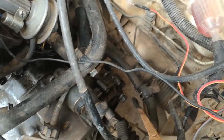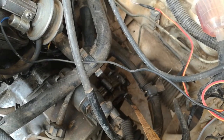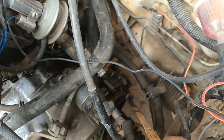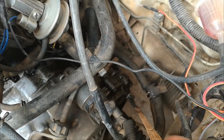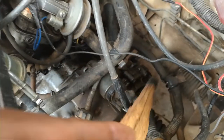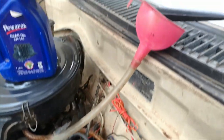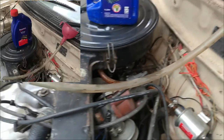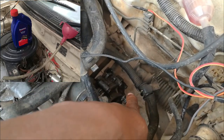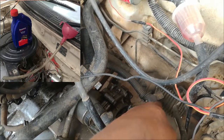Once you open it, if the gear oil is enough it might drip out. If it doesn't have any or the oil is less, you will not see any oil dripping out. After you have drained, you need to use a funnel with a pipe — this is my funnel and pipe — and insert it inside the hole after you open the cock, and then the oil will get into the gearbox.